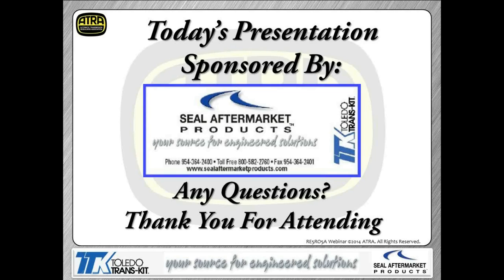This is the Type 1 valve body system. It's easily identified by the two blue connectors. Now, this system was only found in the Infiniti models up to mid-2004. After that, any models for Infiniti or Nissan received the Type 2 system, which has the TCM on the valve body.